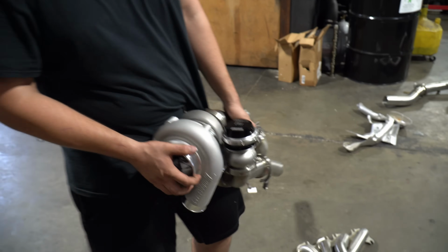So eventually we're gonna go to a built 8.5 trans, turn it up, stock motor, and then swap from a 6262. We wanna put it on a dyno, put on a 6466, and then see what it does. Pretty much a back-to-back comparison from the turbo upgrade, and see how much power you gain. So other than that, that's what we're gonna be doing today.